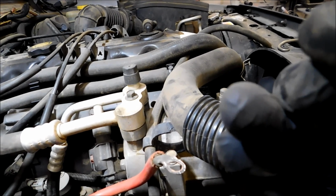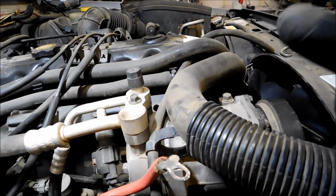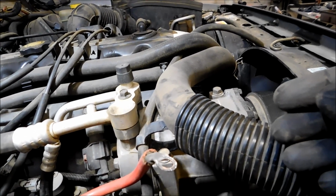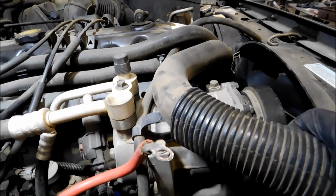They're made for different materials, and if you use the wrong one on the wrong line, the material will eat the gasket, and then the gasket will fail. So just an FYI when you're looking at them, if you're wondering why they were color coded, it's greens are ACs, browns are fuels, and blacks are vacuum. So that's that.